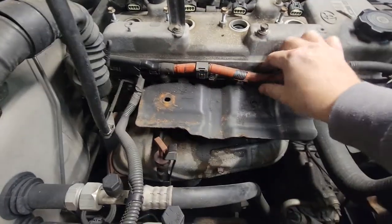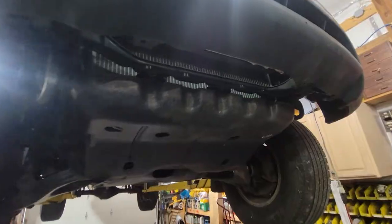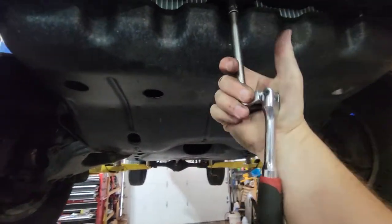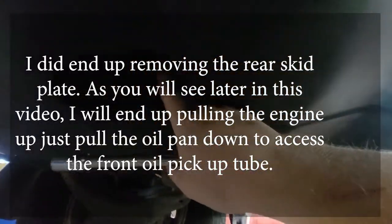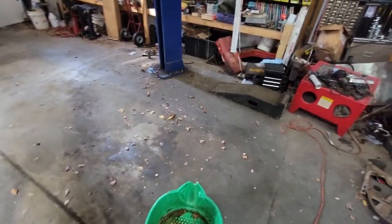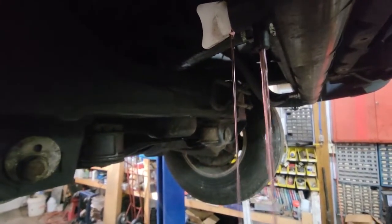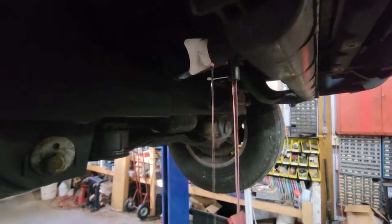Two 12 millimeters to hold this plate on. Going underneath the truck, we have three 12 millimeters on the front just to remove the skid plates so we can get to the radiator — three up here, four, and five. Grab a catch pan. You can loosen this up and see what comes out. Well, it's pink — that's a good sign. I don't see oil yet, but oil would be on top because oil floats on the water. I'm just going to let this drain and do the oil next.